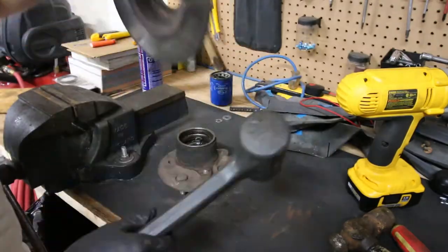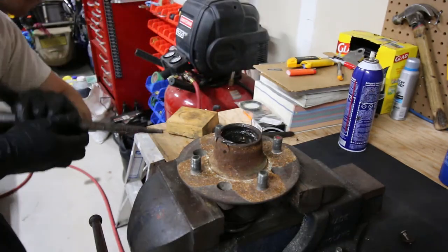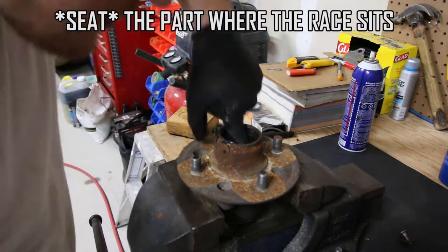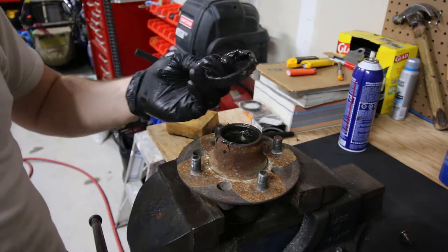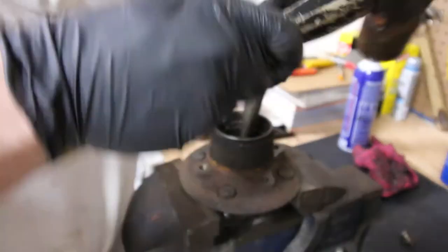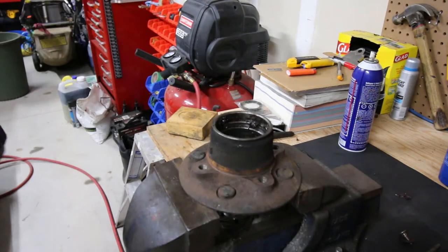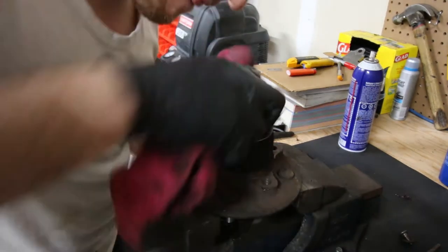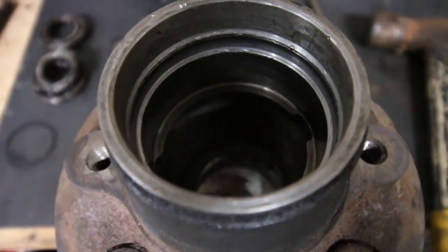Now what I'm doing here is feeling for some notches — we have to take the races out and the seal out. There are notches on either side of the race of the bearing, and I'm just feeling for that little notch and using a punch to punch out the race. That is the inner race. We're going to flip the hub around now, feel for those notches, and bang out the outer race. This is a pretty greasy job. I'm just trying to get the grease out of here and start fresh with everything new. You can reuse the grease if it looks good, but in my case I don't know when this was last changed. Now it's all cleaned up and we have something fresh to start with.